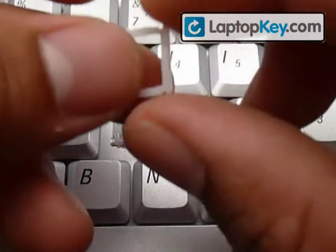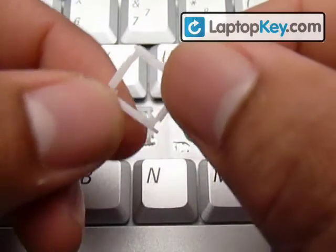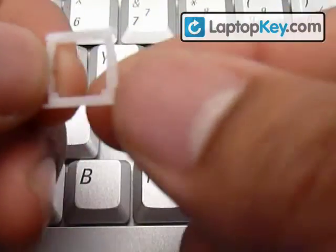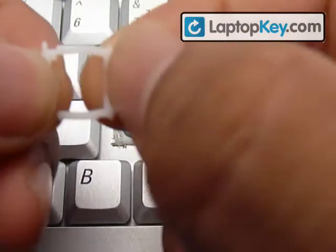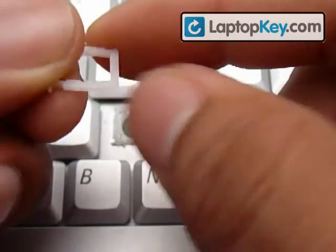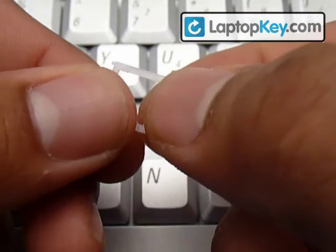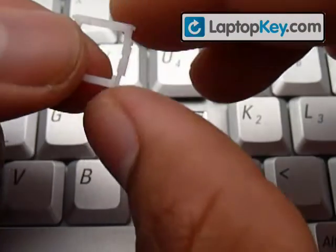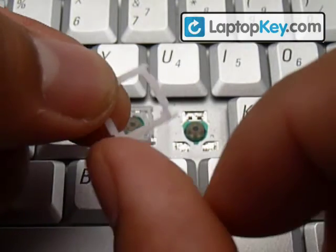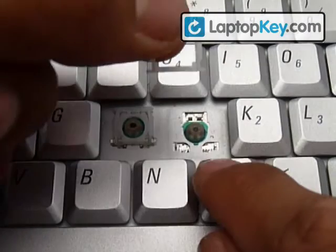Get the big one first. Make sure you're not going to put this upside down by looking right at the edge here. See how I can put my nail right in there. If you were to flip it over, it's smooth on that side. So the smooth side you want to go away from the keyboard. Then you choose whether to put it with the large sticks going up or down by looking at the metal plates on the keyboard.